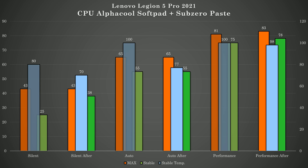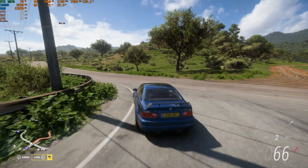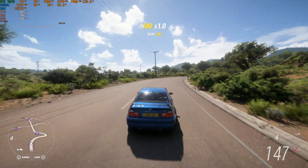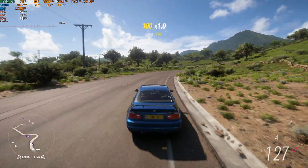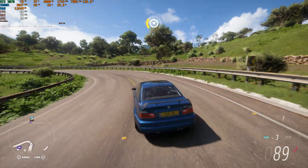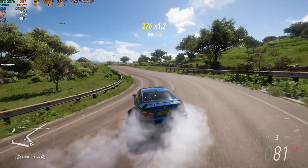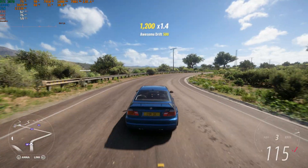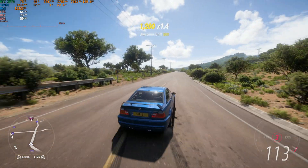Those or any other hard pads were causing the problems. Now, a few extra words while driving my favorite car in Horizon 5. This cooling block is not okay — tolerances are terrible and even when using the correct pad size, I cannot guarantee that it will work. The best solution here and in general would be putty-like pads that will work in any situation. Are they more expensive? I really do not know, but this problem would not even exist if they used them.